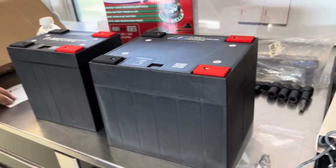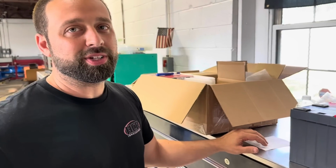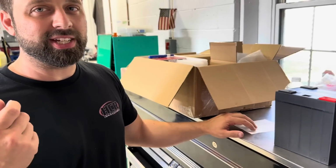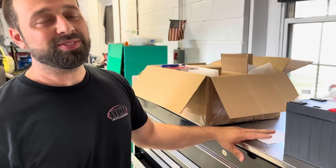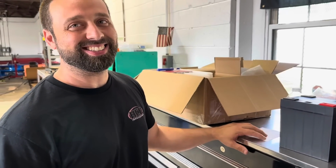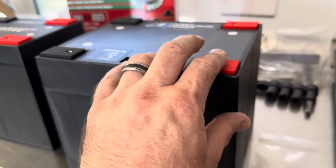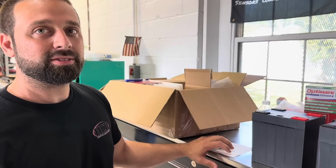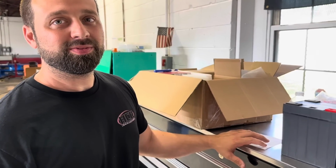I'm going to show you how fast this one spins over versus the one I've got in the car now. The one I've got in the car now, there's nothing wrong with it. It's about 150 RPM or so. You just hear it when it first hits it. It kind of pulls it down and then it comes up. I've got a big hog of a motor now, 532 cubic inches, about 13.5 to 1 compression. I don't think it's going to stop this battery. When everything's cold, that's hard to get going. It is. And it's amazing when Randy swapped over to this battery, it was wild as all get out. The difference is almost hard to believe. It spins them over like there's no plugs in it.